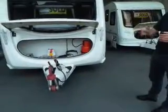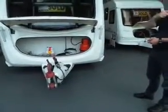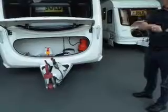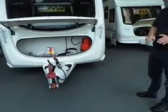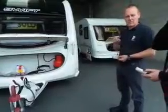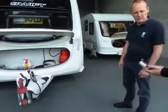Other thing also — once you get it onto the car, the last thing you want is the motor mover wheel still on the wheel when you're travelling off down the road. What we recommend is: when you've manoeuvred it, put the handset on your seat — either put it straight onto your seat so you don't forget. Don't put it on the A-frame or on the roof, because they're likely to disappear as you're travelling down the road. If it's on the seat, it's going to be a reminder.